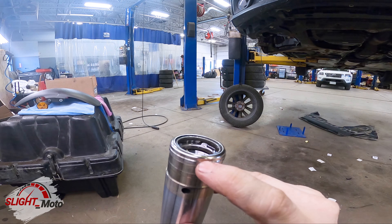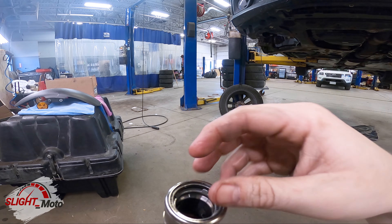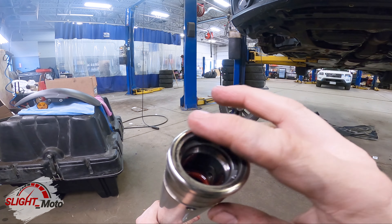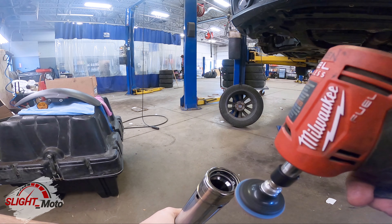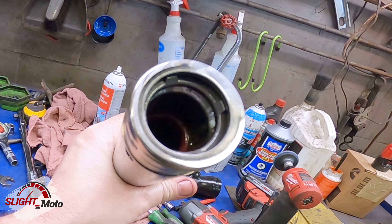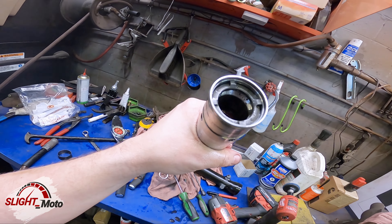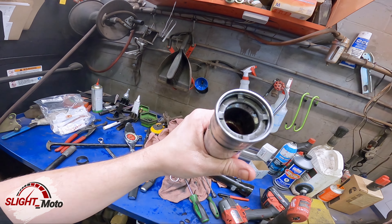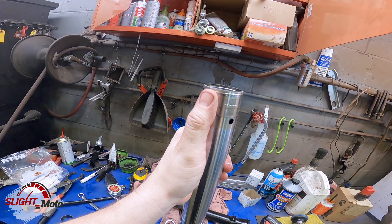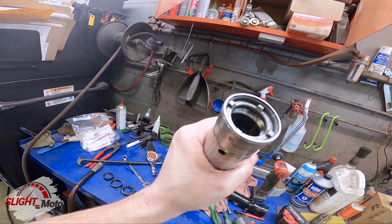It's about a millimeter off of this mark, so there are collars right up top. We're just going to trim it down until you can see them, because all you're doing is getting rid of the mushroom portion that holds that on. You can see it's starting to come through so I'll cut it further. I've knocked off the one outside piece, now I'm going in further, measuring off that one-millimeter ridge. Trimming it out so I can pull that out now.